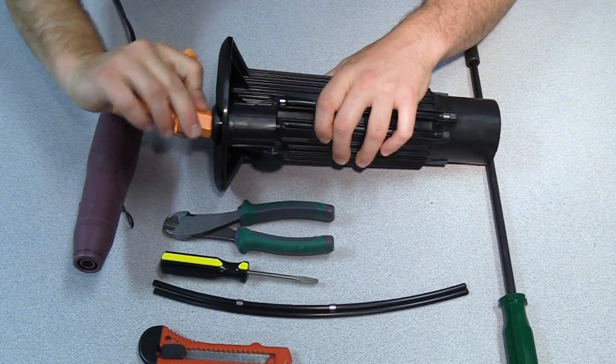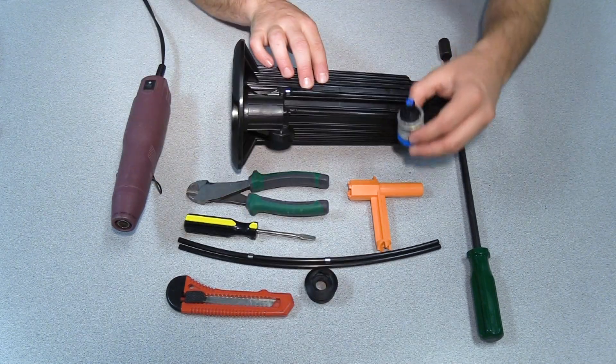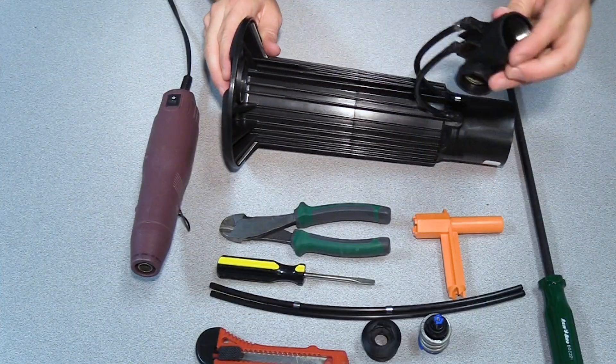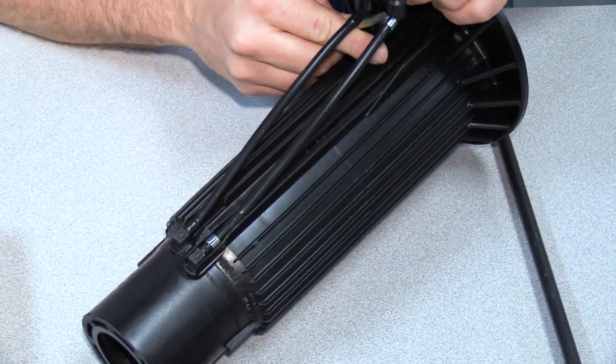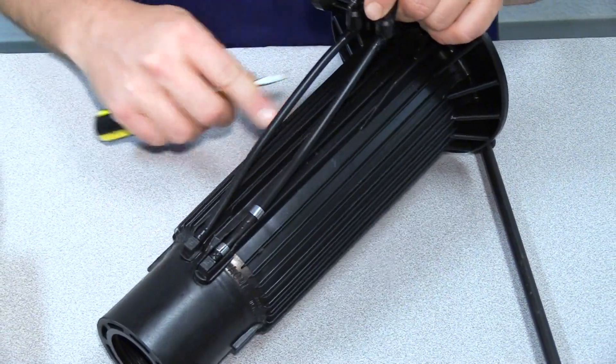Using the selector service tool, remove the PRS retaining nut as well as the PRS cartridge. Dislodge the PRS housing to allow the tubes to come out of the channels on the case. Using a flathead screwdriver, slide the retention clamps out of the way.